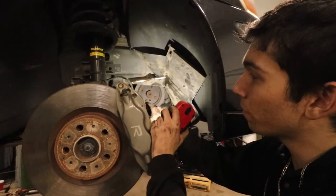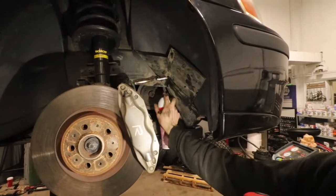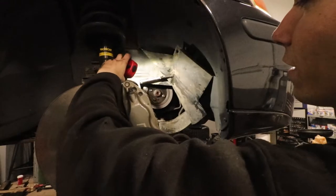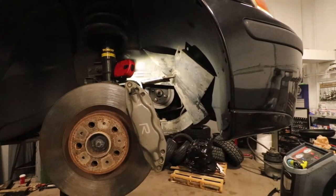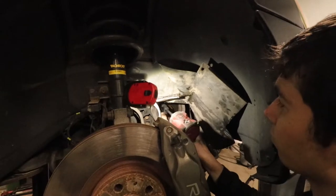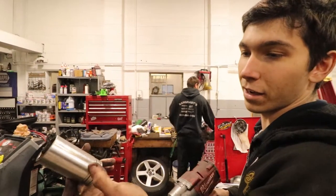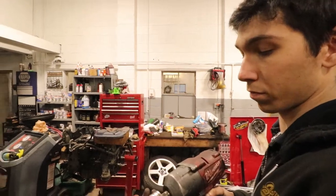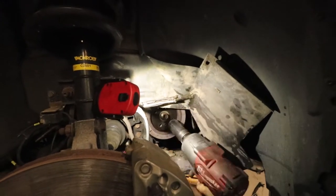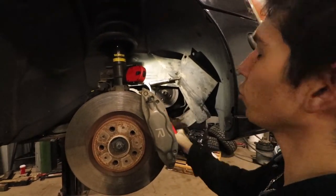Next step, we're going to take the balancer off. It's four 10mms and a 30mm in the center — that one will be extra crusty. Don't forget to spray down your bolts; you don't want to break one of these. The standard socket size is one and three-sixteenths. Just make sure you don't break it when hammering — gently, back and forth. You could use a rubber mallet too.